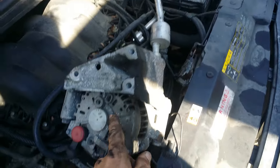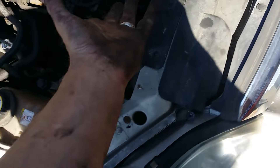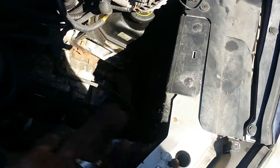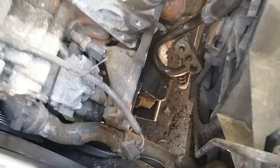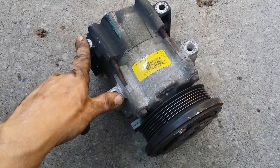There are three main bolts holding on the AC compressor bracket — I mean the alternator bracket. I left the alternator on; you can take that off and maybe make it easier for yourself. The AC compressor itself is held on by four fasteners. They each have a 10 millimeter head — this is where the 10 millimeter ratcheting wrench came in really handy.